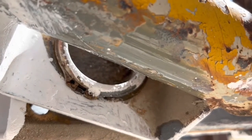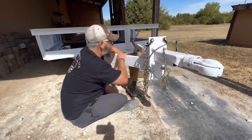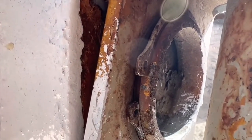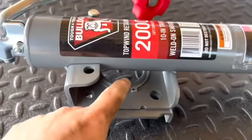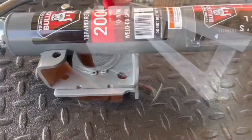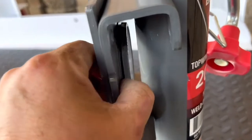There's a snap ring in there that you have to remove to be able to remove the jack from the trailer. After many minutes of fighting with it — see how this is up just a little bit now — I should be able to pull that snap ring out. It's a two-ton jack that I got. We're going to take that snap ring off, disconnect the weld-on plate from the actual jack assembly, and reinstall it.